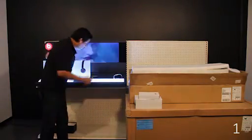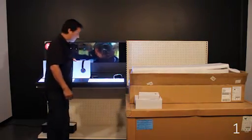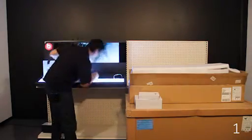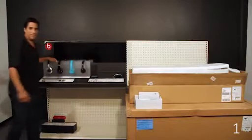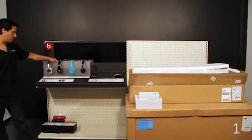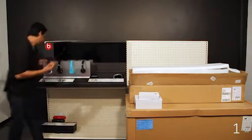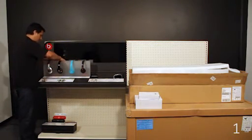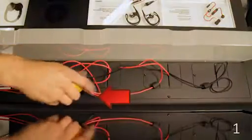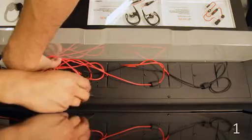Now you're going to reach inside of the display and kill the power using the 4-position outlet strip that's in here. You're going to have to stick your hand back here, but there is a switch that will turn off the power to the display. Now we have no power on the display. Next, we're going to take our security tool again and remove the security screw that holds in the 4-position headphone block. Once again, remember to keep track of your security screws.